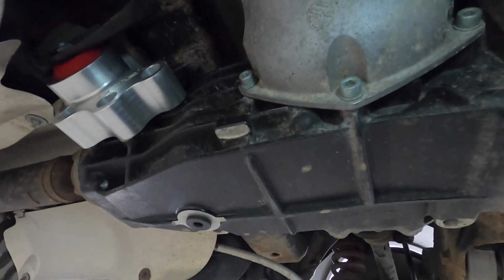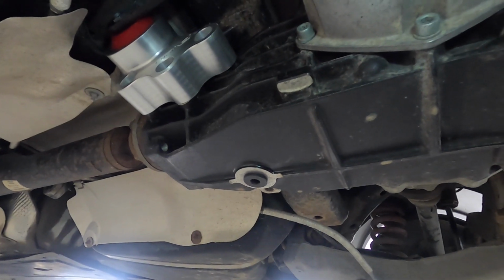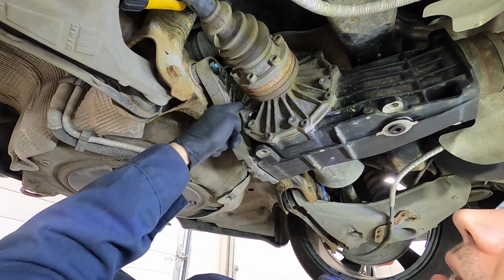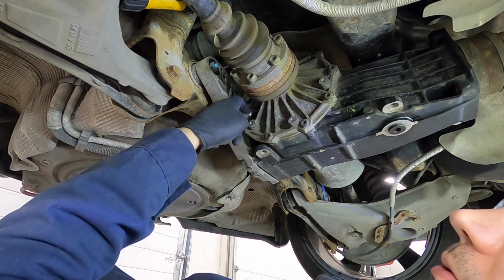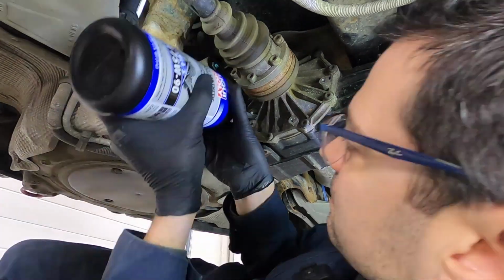And while I was here, I took out the fill and drain plug, drained the diff, and now let's go ahead and do a fill on the diff. Ain't nothing scientific going on back here. There is a bit of an axle shield that's usually right here, so I took it off to get access to the fill hole, but this case holds 1.5 liters of gear oil, and there's no sort of below-the-hole leveling kind of thing going on. It's just until it comes up to the bottom of the hole, that's when it's filled.